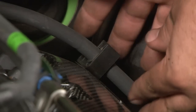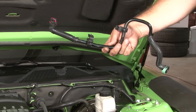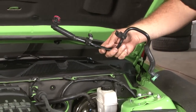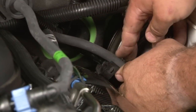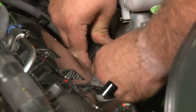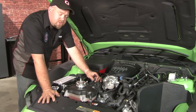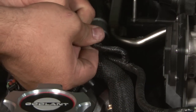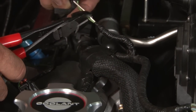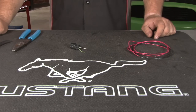Remove the line and the stock fuel line clamp, then install the new line to our purge valve. The red clip's gonna go on top behind the intake, the green clip under the brake booster where we just removed the other line. This is the factory wiring harness for the purge valve. On the original intake the purge valve is located up front so it reaches fine, but on the Boss we've moved the purge valve to the back, so we're gonna have to cut this harness off and extend it to the other side. Ford recommends about 40 inches of wire — stick with that recommendation, as you'd rather have too much than too little.